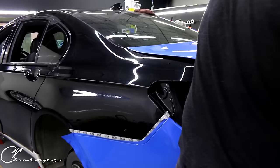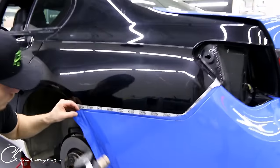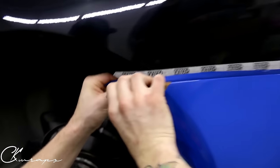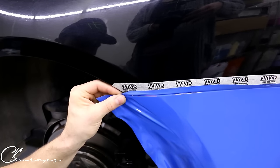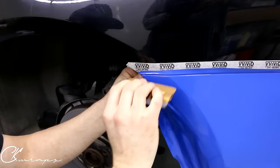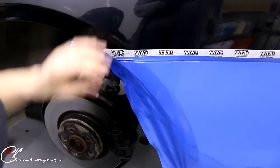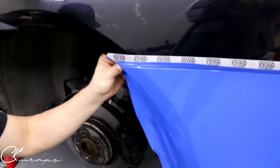When we get down to this corner over here we want to tuck the film in, make sure it's good. We want it to roll around, so we need to apply a touch of heat — we still need it to roll around this side. You don't have to remove the bumper to do this; you can do it in exactly the same fashion. What I'm gonna do is relax it, glass it out a little bit more, and then start trimming.